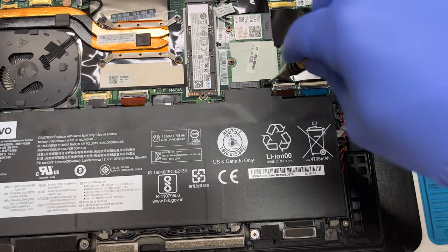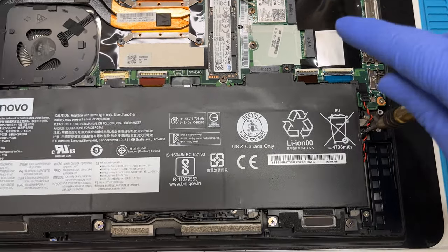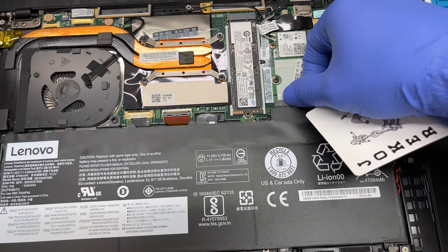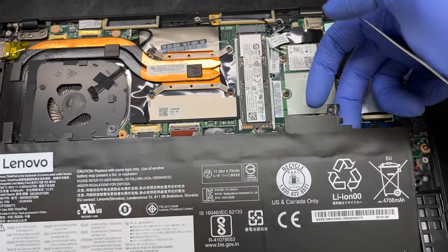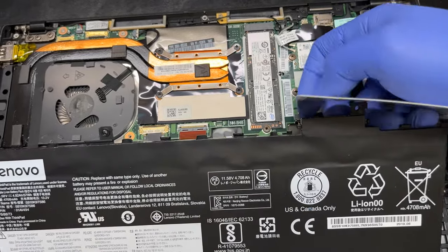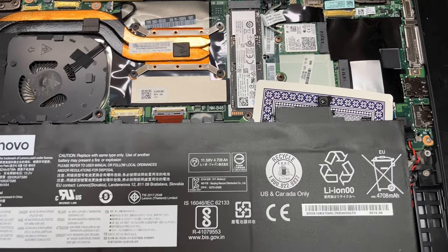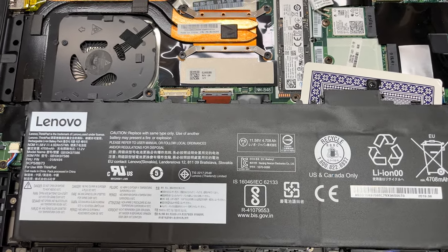What I'm gonna do is remove every single screw. I'm not gonna take the battery out completely — I'm just gonna pop it up a little bit, just like that, and put this card underneath it so that it does not make contact with the metal pins. I'm lazy and I don't feel like removing it, so that's what we're gonna do.